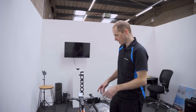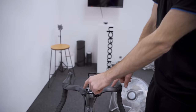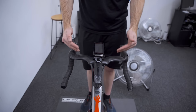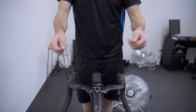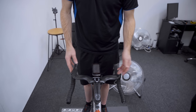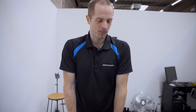The bars Chris has on the bike are Onyx bars. If you look at them, the stem clamp sits set backwards relative to the top section — normally the stem is in line with the top, but there's an extra section here which effectively pushes the bars forwards. The reason we do that is because these are purely designed as a race bar. An extended reach position is often a little more aerodynamic, and it allows you to increase the reach and get more clearance for sprinting and being out of the saddle. Without changing the stem length you can increase the reach just by fitting the bar, but if you already have a narrow bar you might need to put a shorter stem on.